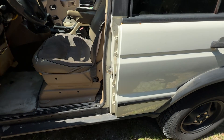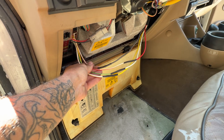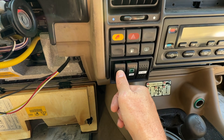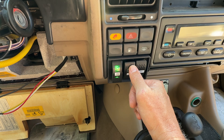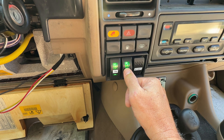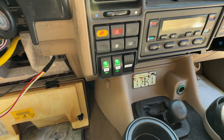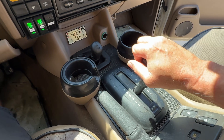Nothing's on fire and none of the wires are hot — we should be good. If I hit start, nothing should happen. And yep, nothing happens. Now let's see if a light comes on with the first switch on. Now let's see what happens when the ignition goes on — that's where I get my ding. Once the ECU powers up, the start should work. And yep, it does! The neutral safety switch and interlock work too — it's going to work. Now all I have to do is completely get rid of the lock cylinder, because the steering wheel will lock unless I remove it.